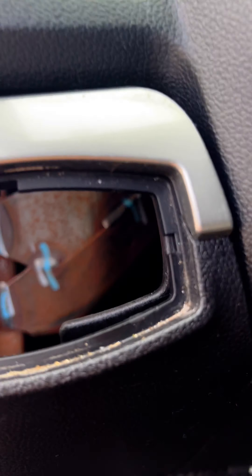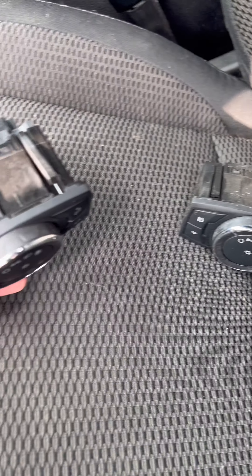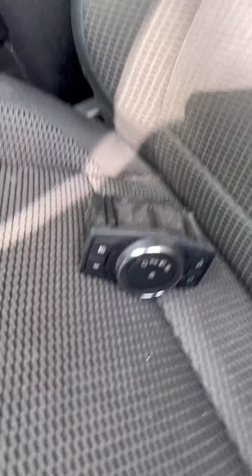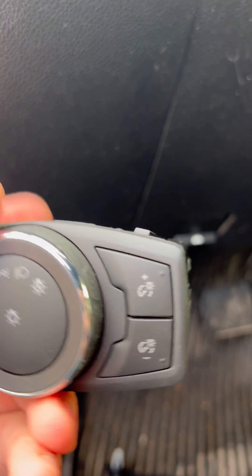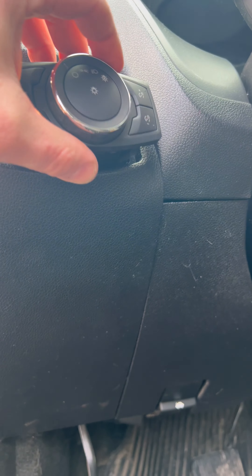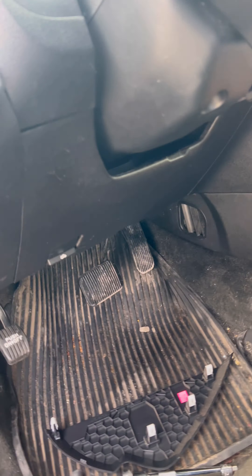It's really just a plug in the back, and then it goes back in. There's the new one, there's the old one. What happens is these actually had a fault in the logic within the mechanism, and it just causes this parasitic drain at times in these cars. So if you have a constant battery drain and you don't know where it's coming from, you get a new battery, it's likely this issue. This is a really common issue — I'm actually surprised it wasn't a recall.